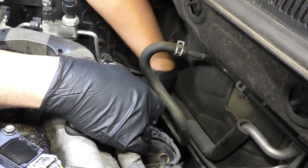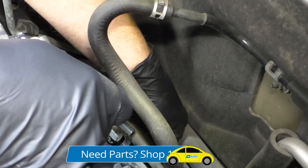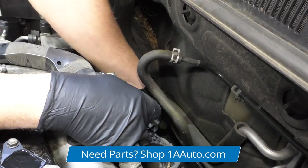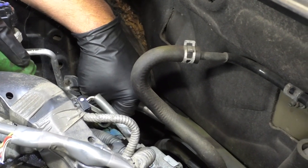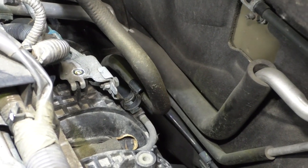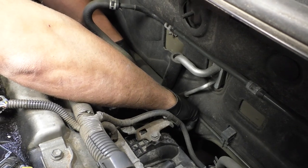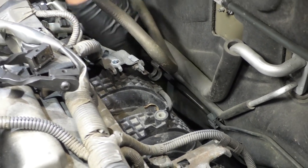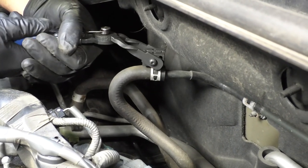There are some hoses attached on the side here — it's going to be kind of hard to see, but we want to take those hoses off. This one just has a little clamp that you can move with your fingers, then you can try twisting the hose. If you need to, you can take a right angle pick and just get in there and loosen up the hose. There's another clamp on this vacuum hose. I'm going to use my hose clamp pliers, squeeze the hose clamp, and just try to move it down the hose — just twist the hose and wiggle it off. Got it off. These hose clamp pliers work pretty good — you just line it up with the clamp and then squeeze it.